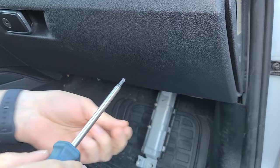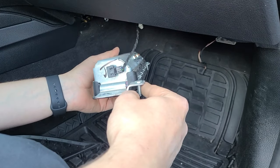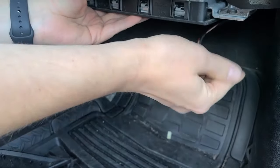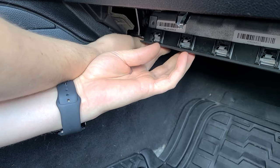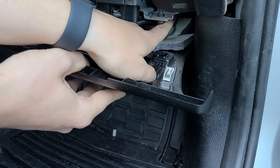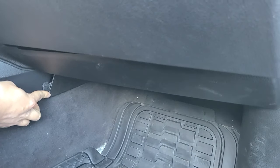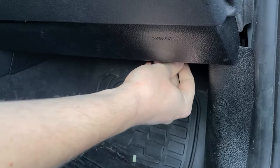Put the four bolts underneath the glove box. Put the airbag back — the end with the two bolts sticking out has to be closer to the front of the car. Take the two T30 bolts, put them in, do both sides before tightening. Now take the panel under the glove box, connect the light, and put it back — make sure the holes line up with the bolts. Clip the panel in, ensuring it goes behind and isn't sticking out. Screw back the 10 millimeter nuts.